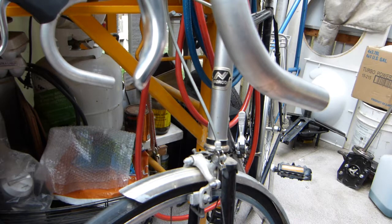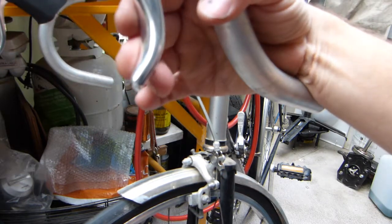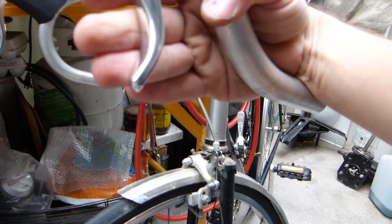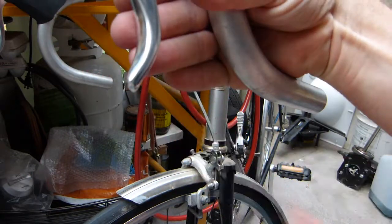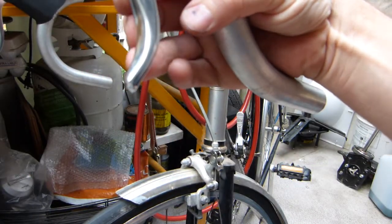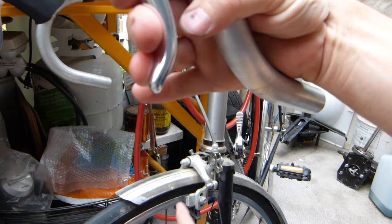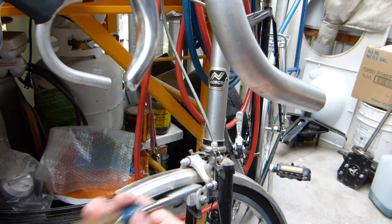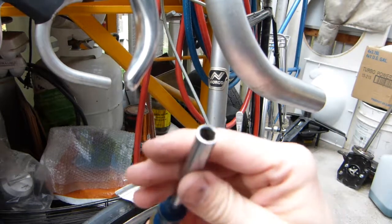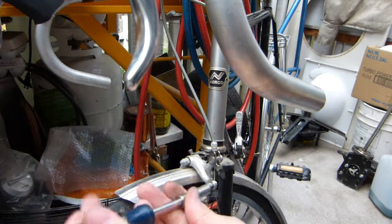Of course it can be set up a little further apart, because the lever cannot be adjusted to your finger length, but if you have shorter fingers, it's going to be a little too far away. You want the lever to be pulled a little bit without the pads touching, so it can be accommodated to smaller hands by loosening the cable with this single 8mm socket on a socket handle, like so, a socket driver.